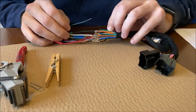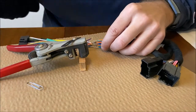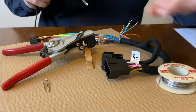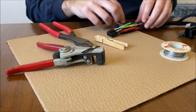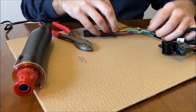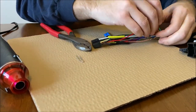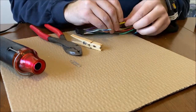Once I'm done with soldering, I also have to realize there are about five wires that I'm not actually going to use because of my application — just the way my Cobalt is set up. You can see I've got them folded away so I don't solder together the wrong ones. Once I've got it all soldered together, I just trim up the ones I'm not going to use, make it look nice, and then start working on the heat shrink tubing. Since I put it on before soldering, I can just slide it forward and use the heat gun one at a time to get it all looking pretty good.